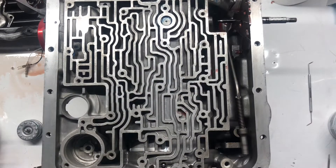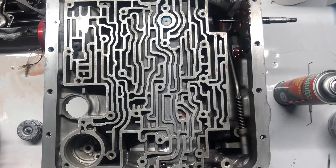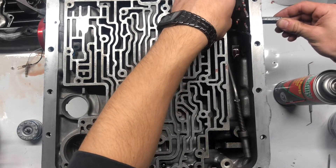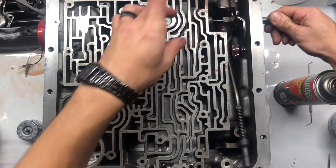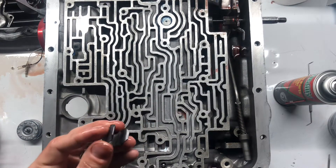Once that's on there, I'm going to take the washer — I left it in my parts washer, so I'll rinse the cleaner off with brake clean, dip it in some fluid, and then it goes on just like that. Do it hand tight for now. The selector can only fit in there one way because it's keyed — it's like a little rectangle — so get that in there hand tight.